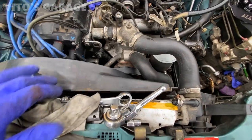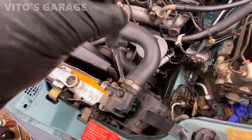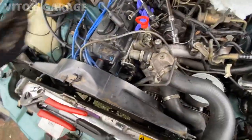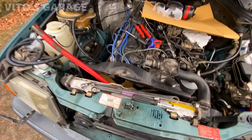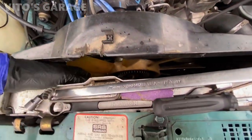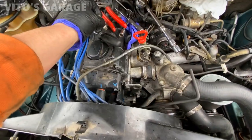There's the clip. Now we can move this — it wasn't installed properly, it has to go into that slot and it's kind of broken. Here's the tool I had to trim a little bit so it fits right — it's an 8-millimeter ready to loosen the fan clutch and take it out. I loosened the fan clutch bolt counterclockwise, then carefully removed the whole assembly — the fan shroud and clutch together.